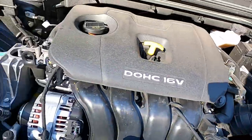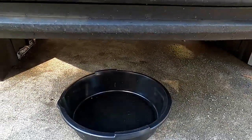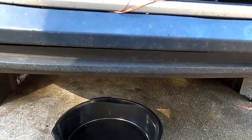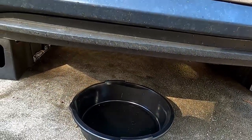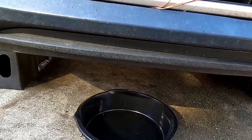Check all your fluids up top — coolant, water, brake fluid, and oil. I need to put some more in that one. Check all that out while you're here. Then underneath the vehicle you're gonna do a drain and replace the filter. First thing we're gonna do is take the drain plug loose and empty out the oil, then take the filter out.